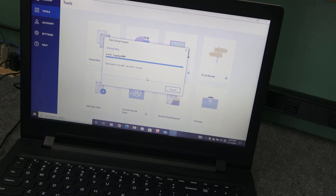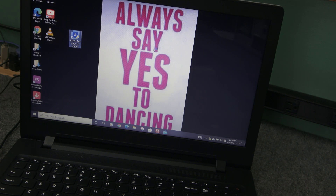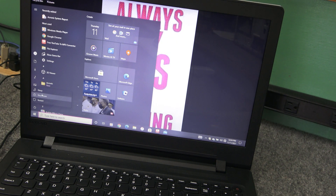Alright guys, I'm back — just about done here. Copying MBR is the last step, other than synchronizing. It's taken a little over 10 minutes, about 11 to 12 minutes total. Once you're all done, get the new SSD in and boot it up, then you can easily uninstall the Acronis cloning software if you don't want it on your computer — just uninstall it like any app. Successfully cloned — that's always good to see. I'm going to close the program and shut down the laptop so we can install the new SSD.